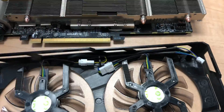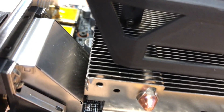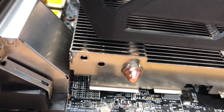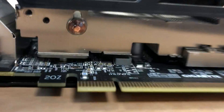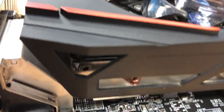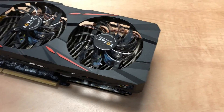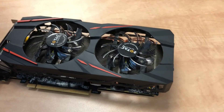We're going to attach the cage, lay it on, plug in everything, and screw it back together. When you're screwing the cage back on, these tabs where the screws go don't mount to the outside — they actually mount into one of the slots, probably the second or third slot on each side. You have some wiggle room, actually probably the first slot. When you're sinking your cage back in, try to put that tab down into the first slot, then repeat the process around the rest of the card. It helps to do one side at a time.